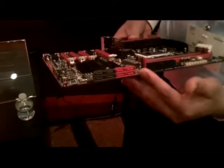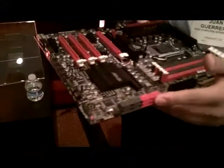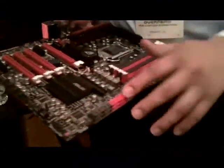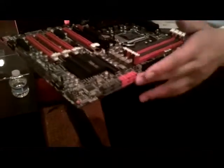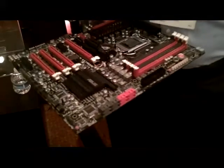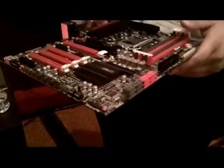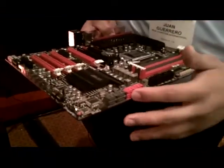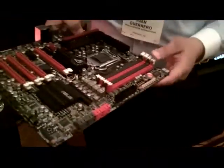More I/O here. The special part is that this is the only board using Marvell's second-generation SATA 6Gb/s controller with their higher-performance PCIe 4-lane interconnect. Previous controllers are fine for single drive performance, but when they cap into PCIe they cap on bandwidth, so they're not great for RAID configurations. This gives you performance more comparable to what the Intel PCH is providing.